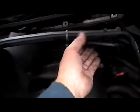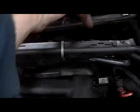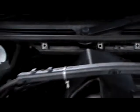There's a fair bit of dismantling to get all that off. Three screws have to come off here, just unplug the loom here — just pop in a screwdriver, pop it up each side. There are little tabs there and one there, then that pops in and grabs the tray. Lift off the tray — three studs there — then lift off this cover here.